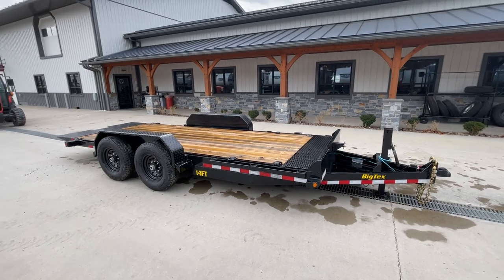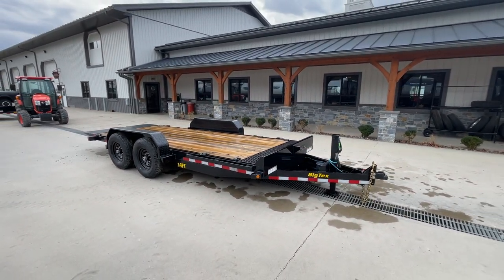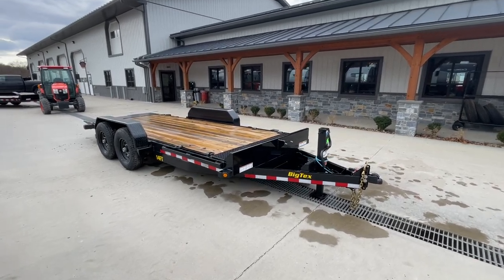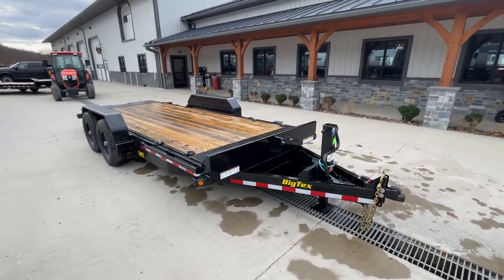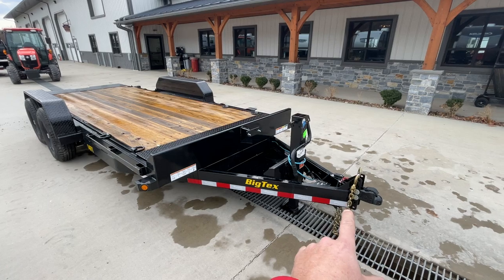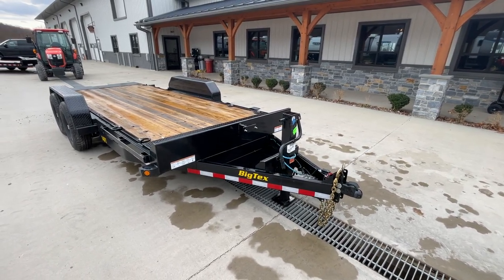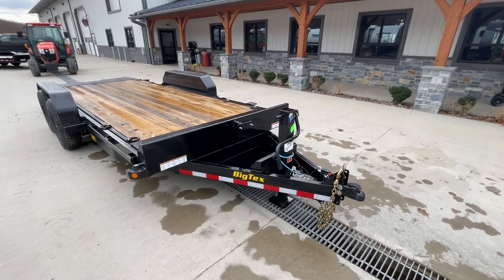It's going to weigh just a little bit over 3,000 pounds. So on a 14,000 GVW, you're going to end up with about 11,000 pounds of payload. If on a rare occasion you need a little more than that, you will get another roughly 15% tongue weight to the truck side, which is going to net out to about another 2,000 pounds.